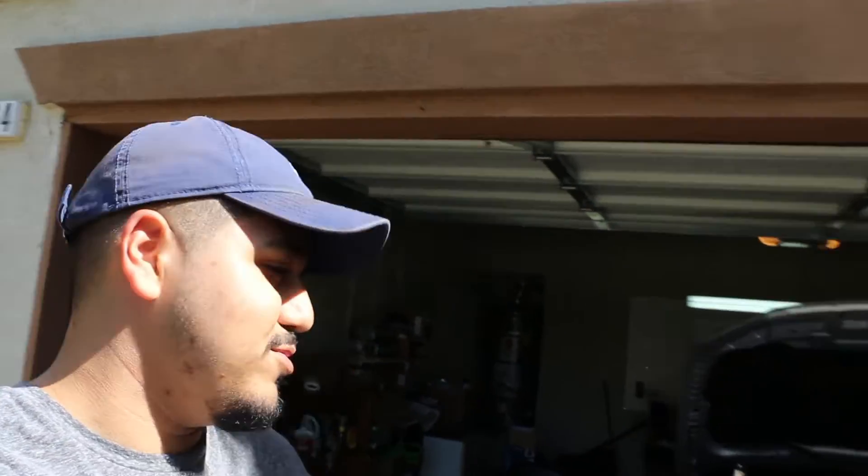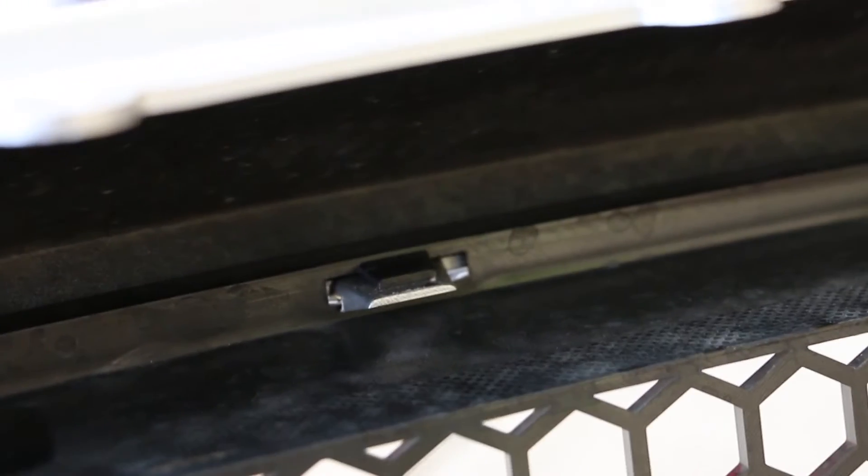Thanks for watching. We didn't really do a how-to, but if you already know how to take off a bumper, it's basically just taking this off and putting it back on. When it comes to the top grill, you do have to bend little plastic tabs — they're curved so they curve in like a hook, so it won't let the part of the bumper go in all the way. What you do is use tweezers or pliers, twist it up to make it level and flat, and then you can lock it in all the way so it'll look flush with no gap. That's basically it for installing the bumper.